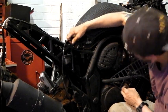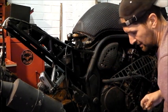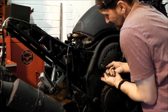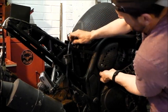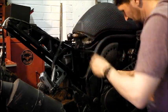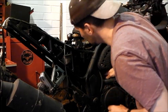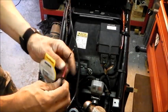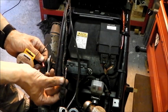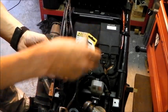I don't want to be taking the air box out because they are a real pain to get back in. You can get a fingertip to it but it's a tight squeeze - come on, you little so-and-so. There we go, that's it - got it! All that's got to do is find the path down to the back of the motor. This little earth wire comes out of the loom and just joined the earth terminal there, so obviously it's not long enough, so I've got to extend it with some extra cable.